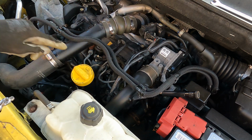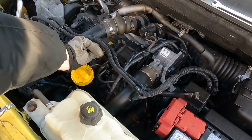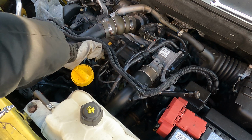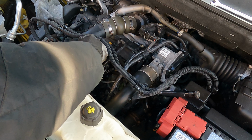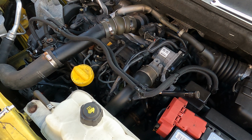I'm going to get the pliers, take my socket out and move on to the next one. It's 11 pounds-foot of torque on the glow plugs, which I think was 15 Nm. I can't remember if, I think that's Newton meters of torque, isn't it? 15 Nm. So it's not an awful lot. It's the second one done. Let's move on to number 3.